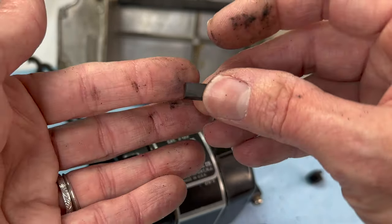Here's the first brush — it's in great shape. I'm only going to wipe it off with a cloth, no chemicals, no oil, no alcohol, no water. Our second brush we remove the same way. They are both left to loosen. The spring did its job — it took the cap for a little ride. Gently pull this out. Most of the time your brushes will be the same length if the motor is running correctly and they were replaced at the same time. This one also has a little bit of a curve in the end. You can put your brushes together to confirm they are wearing evenly.